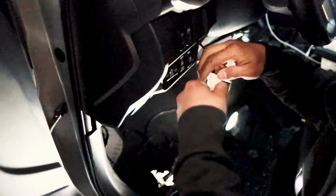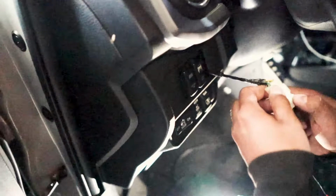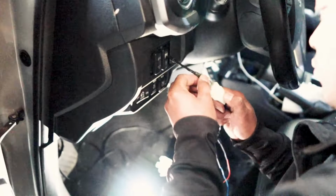So as you guys can see, JJ got the wiring, so now we're just mounting it up and hooking it up to the harness. The great thing about the ARB kit, man, is it's real simple and very straightforward. There's really not much, just matching colors and putting it through. So now I just got to get the button hooked up into the dash, and then find ignition and power for it. And the wiring itself will be pretty much done outside of hooking it up to the battery.